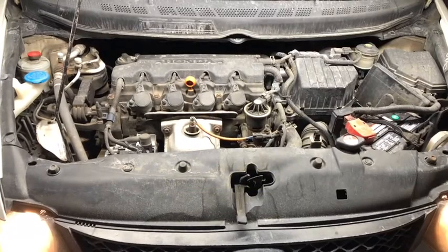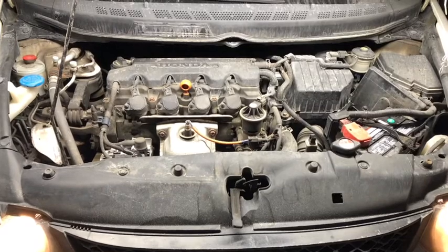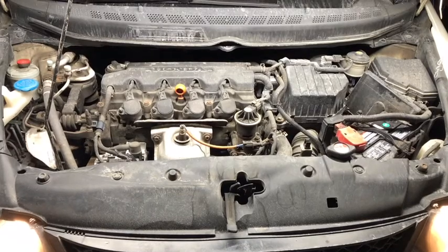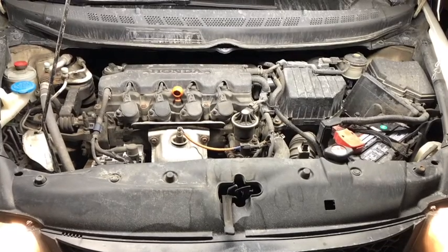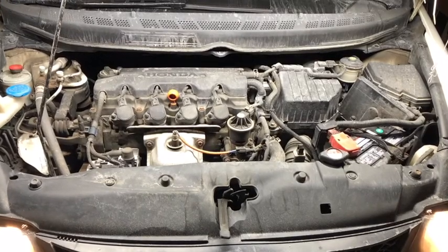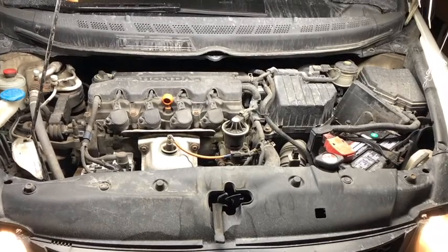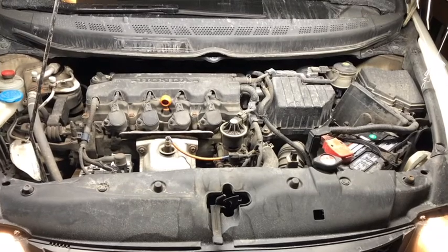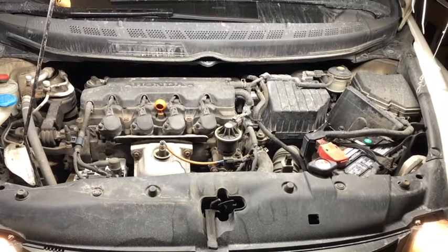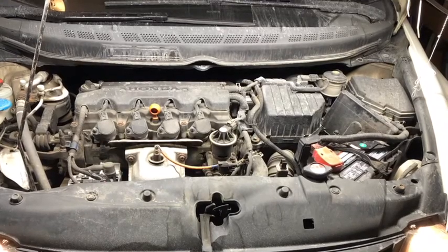That's it, folks — we replaced the alternator and the battery. The challenge of this job was the green connector on top of the alternator: the two wires that broke. I had to fix those two wires and spent a lot of time checking the pin layout and schematic to make sure the wires were in the right position. If you have a problem with those connectors, have a look at this video, verify the wire color codes shown, and match that — you'll be okay. Thank you for watching. If you liked the video, click like and subscribe.